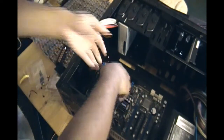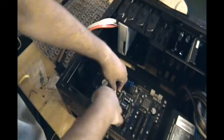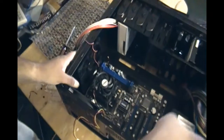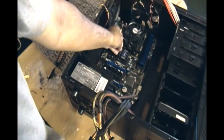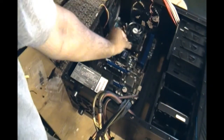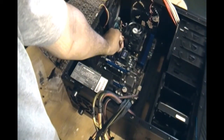Once it's secured, you can lock it. I have both in — make sure you lock it, just pull this all the way and it's locked in. There is your full CPU with the stock cooler. There's a wire coming out of the fan — it powers it and goes into the motherboard. You can find the slot right next to the CPU. Just push it in there through the slot — otherwise you might break the pins. There we go, and it's installed properly.